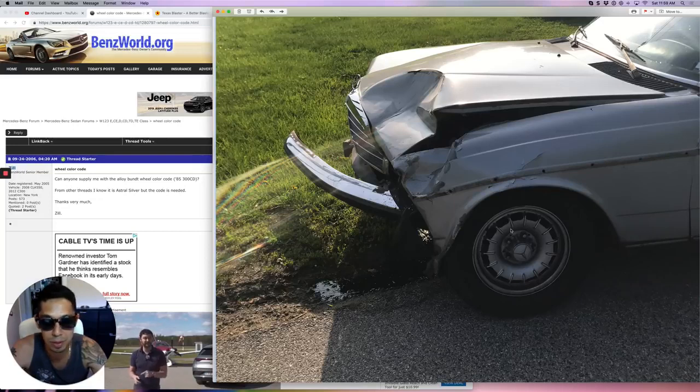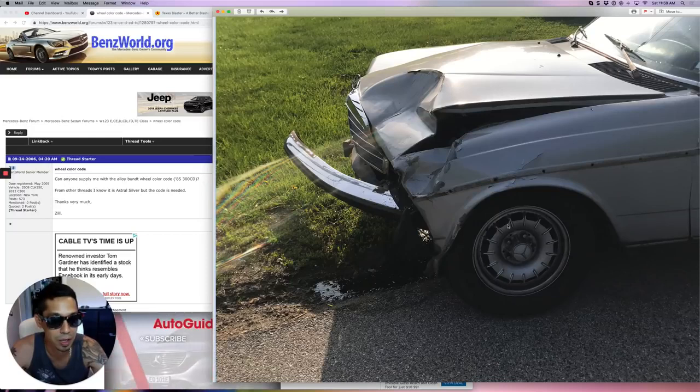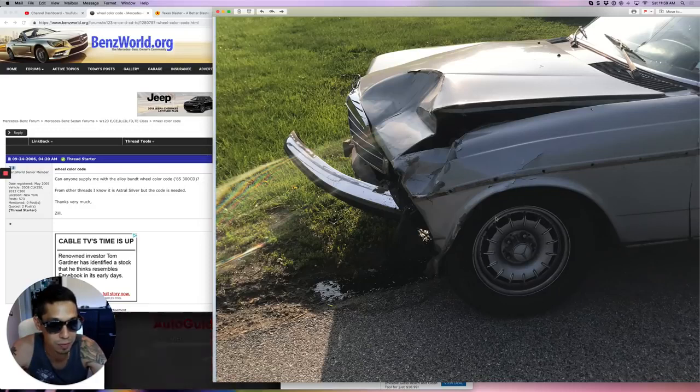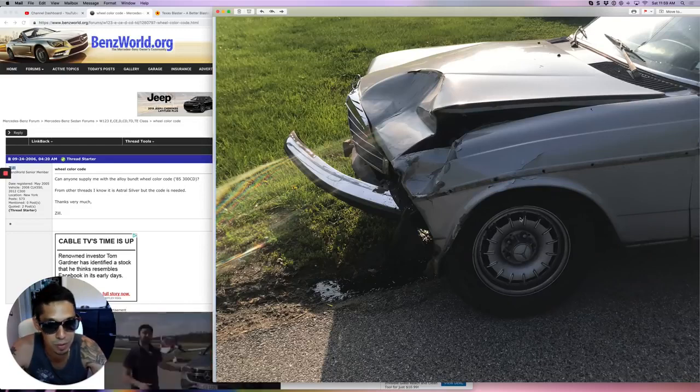Your base coat and clear coat, or you could even do it a single stage if you wish, in your color code. Because if you did the 2K epoxy, then you did the 2K primer surfacer on it, then you did the base coat clear coat, that would be a lot of coats, which can give you problems of chipping when they put the new tire on and off. Do you know what I'm saying? So the less the better. Okay, the less coatings the better on rims.